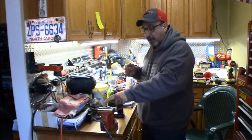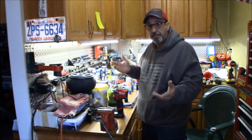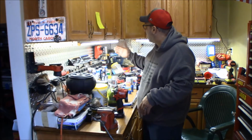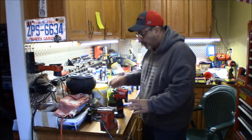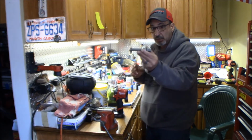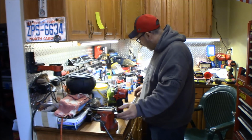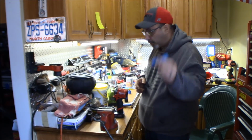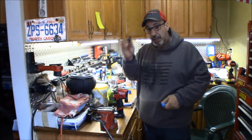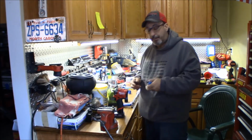So we stepped it down to a half-inch bolt, same thread pitch. It's a half by 13, grade 8 hardened, same way, same setup, same as this, just a smaller one, and it takes a 3/4 inch socket. So we grabbed a half-inch drive 3/4 inch socket, so that we were using the same adapter, same tool, same fully charged 3 amp hour battery.